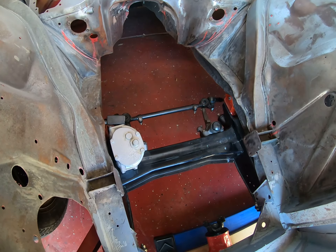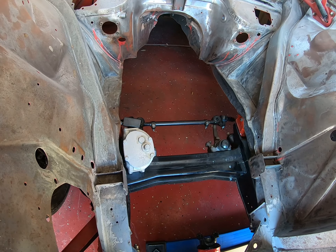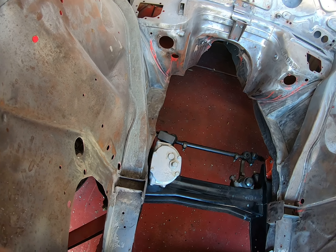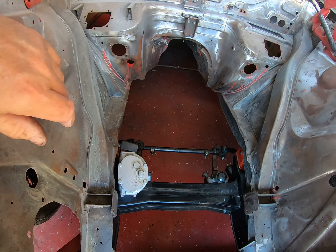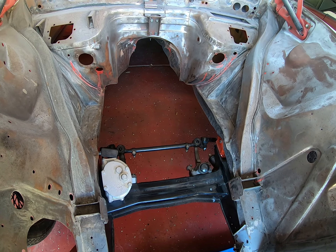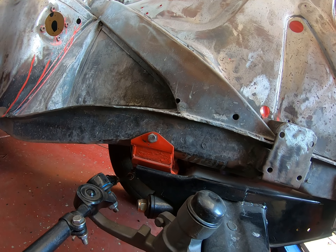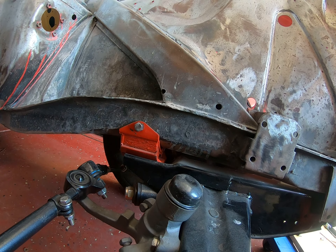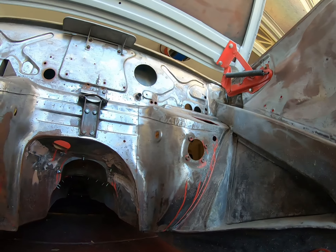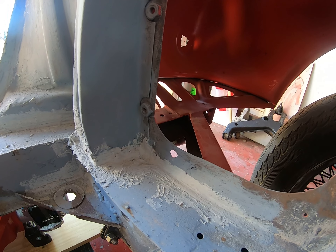The shield over there — I put that back on two days ago. I said fuck it, I'm not going to put stainless steel bolts in, I'll just let the guys deal with it and put stainless steel bolts in when I actually finish everything. Now this down here, whilst it's still a little grubby, is a rebuilt front subframe. There's a little quirk I need to deal with because that should not be at that angle — we'll deal with that. Do make sure when you're doing these rear mounts, put them that way round — I didn't, and when I didn't the front ones didn't line up and I couldn't understand why.